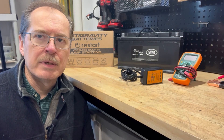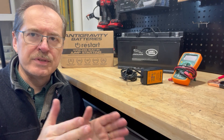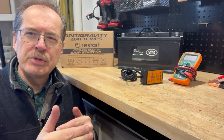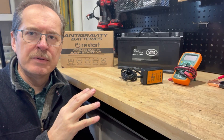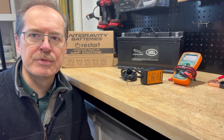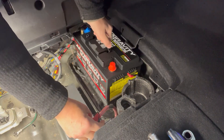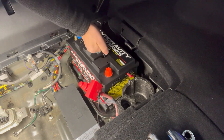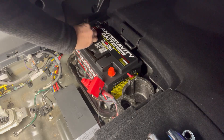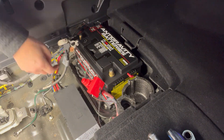The footprint of the new battery is a different footprint, but it's the same width — it fits in the same channel, just a little shorter. It's an H7 replacement of an H8 battery; the original one from Jaguar was an H8A. The positive and negative terminals were located in the same spot, so it was very easy to fit this slightly smaller battery into my Jaguar F-Type. Really no problem whatsoever.